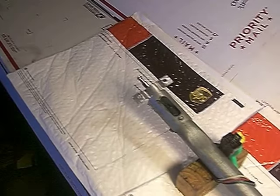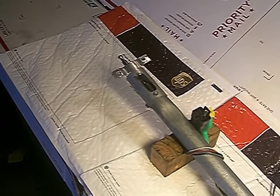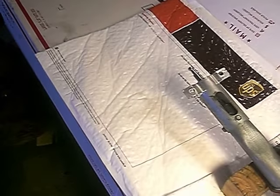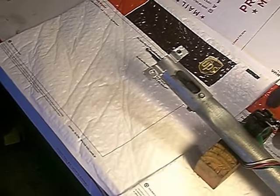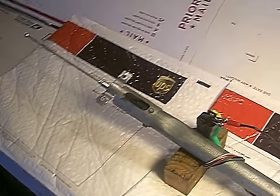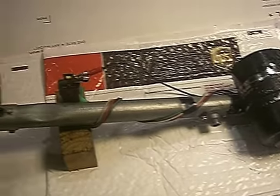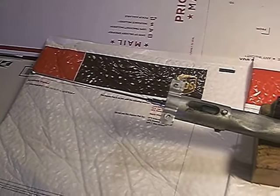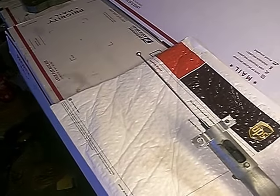I'm going to go ahead and actuate it first in accordance with when you would turn on the radio button and it would rise 6 to 8 inches. So that's the green wire test. And there's the unit, and it orients and rises only for that 6 to 8 inch extension, which is consistent and specific with the engineering for this model year. I'll go ahead and retract it,